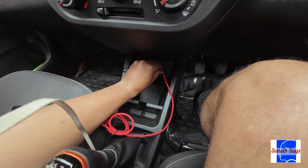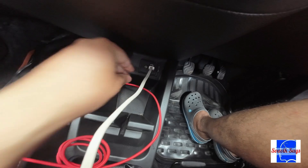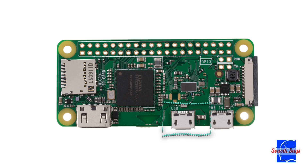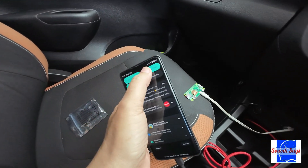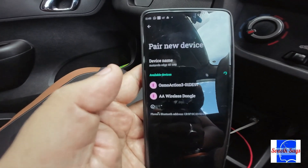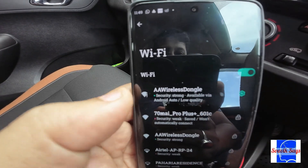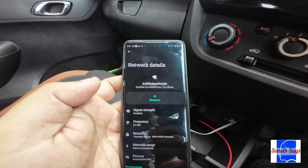In your car, connect your phone with the wire to launch Android Auto. Once Android Auto connects, remove the phone and plug in the Raspberry Pi — ensuring the micro SD card is in it. The micro USB should be plugged into the port marked USB, not the port marked Power In. Wait a few seconds for the green LED on the Raspberry Pi to glow. On your phone, connect to the Bluetooth device named 'Android Auto Dongle' or 'AA Wireless Dongle' depending on the software you're using, and grant it the permissions it asks for. Then open your phone's Wi-Fi settings and connect to the network 'AA Wireless Dongle', using the password 'connect AA wireless dongle' if required, and ensure auto-connect is turned on for that network.